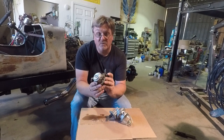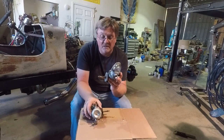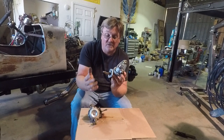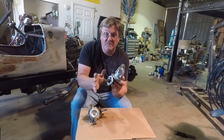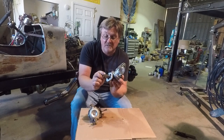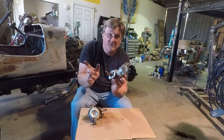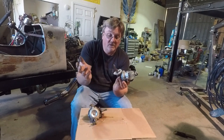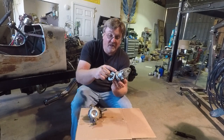I'm almost thinking I should fix the fuel pressure first. This is my old fuel pump — I put it in when I installed the motor, and it was the cheapest one Rock Auto sells. So I'm hoping this is the problem. I went ahead and bought a more factory-style replacement. This one has a glass bowl on it so we'll be able to see what's happening. The bottom part looks almost identical. I did about 10 minutes of research and found there are spacers that can go between the fuel pump and the block — but apparently they just reduce pressure, not increase it. So we're bolting this straight on and going to see what happens.